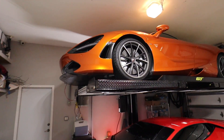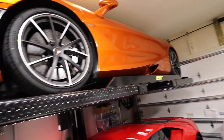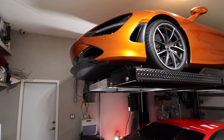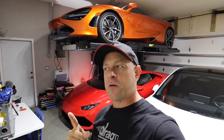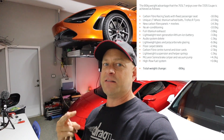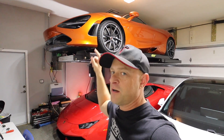If you're wondering why McLaren makes the fastest cars, it's because they always have the best power-to-weight ratio. Things like 19-inch wheels in the front and 20s in the back — you save another probably 10 pounds per wheel by going with a smaller wheel up front. McLaren details every bit of weight savings with different options, such as deleting the AC, going with a lighter stereo with fewer speakers, or a carbon fiber hood on the 765 LT, which saves under two pounds and costs upwards of eight to ten thousand dollars.